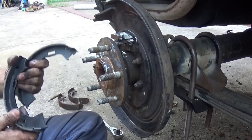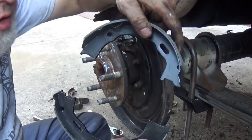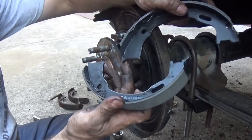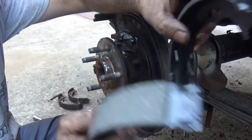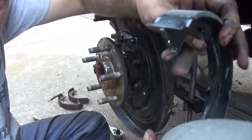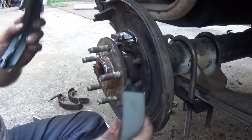Now the fun stuff. These can be really interesting — they're symmetrical but there is a top and a bottom. Your flats are here — notice when you take them off, these are your tops. Notice that's flat up here, then you've got that groove on the bottom right there. The notch is where your adjuster sets in, so that's gonna be at the bottom. Both your notches go toward the bottom.